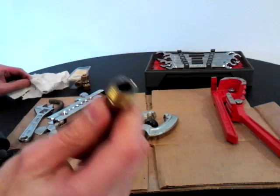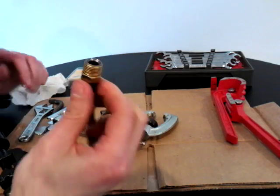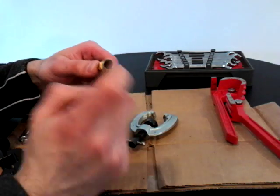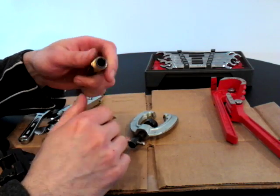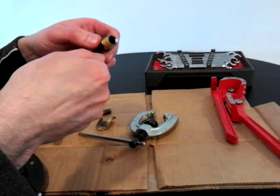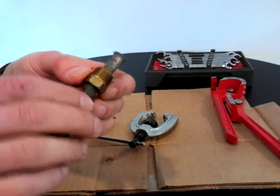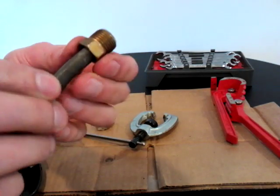When you're done, look for any hairline cracks because those will leak. If you put this on a fuel line, pressurize the system — if you have an aftermarket fuel pump with a switch, turn it on and check for leaks. On a regular car, cycle the key to prime the pump and pressurize the system. That end will have a nice flat surface to seat the fitting perfectly.